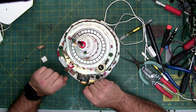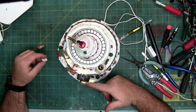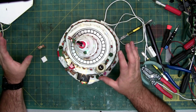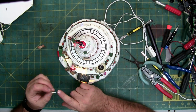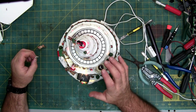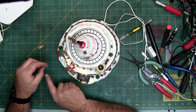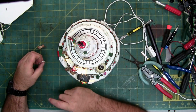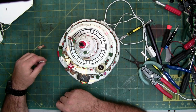So pop him up. I totally forgot he was there, and instead of popping off the pin, it broke the plastic below. But as you can see, it's fixed. Like I said, it's not too hard to fix certain things. I would use the gel on this, clean it with alcohol. The side that broke, which is this side right here, I would clean both sides with some alcohol. Once it evaporates, I'd put a bead of the gel, put it there, hold it, wait till it cures, then run a bead on each side to make it thicker and let it cure, and maybe do it two or three more times so that way it's as structural as it's ever going to be.